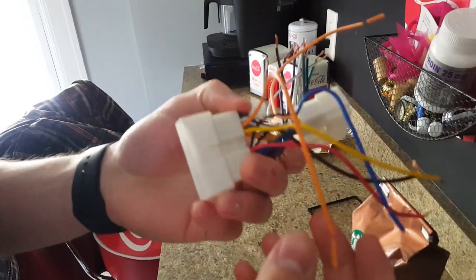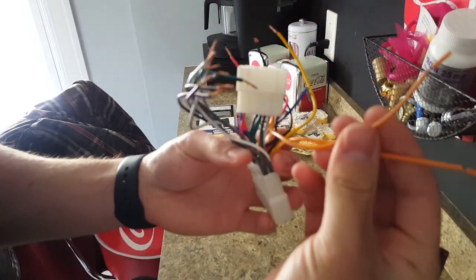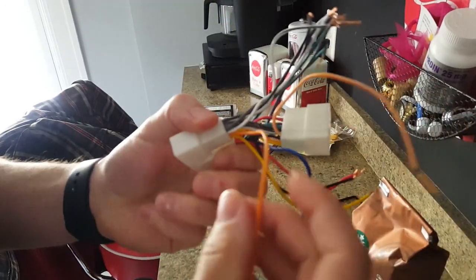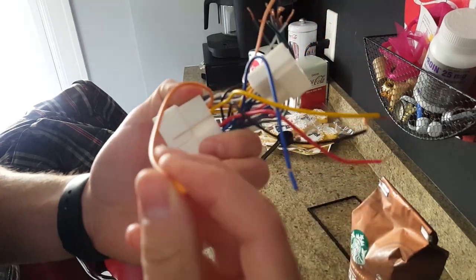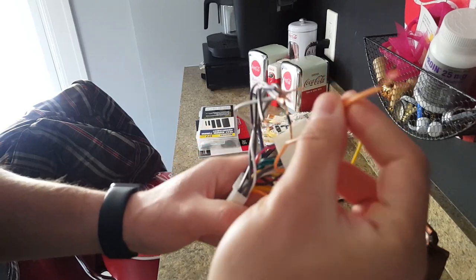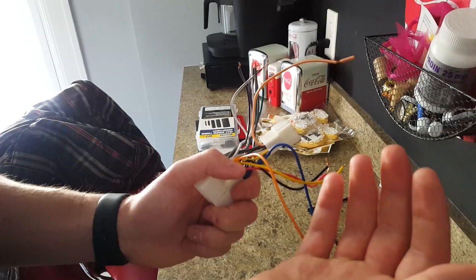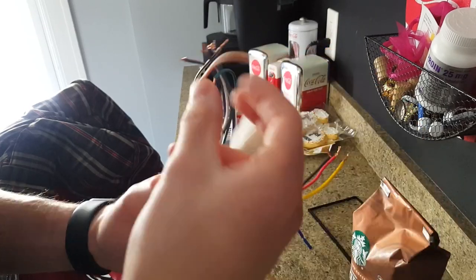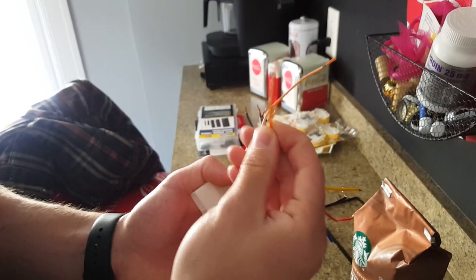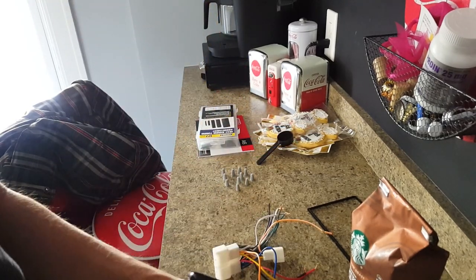One thing to keep in mind: there are two dimmer wires. The one with the white stripe on it is the negative dimmer switch for Hondas — this is used to dim the radio in increments, which isn't used in most aftermarket radios and causes some confusion. The one without the white stripe is the one we want to hook the dimmer wire up to.